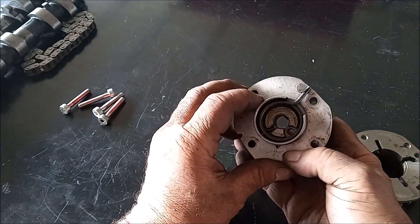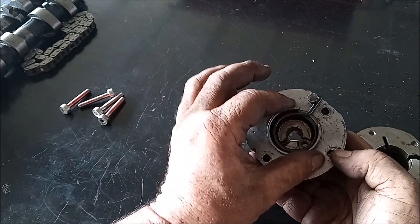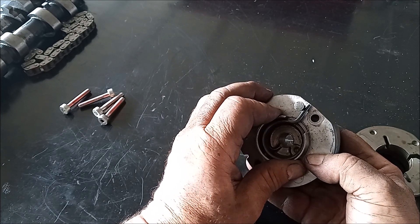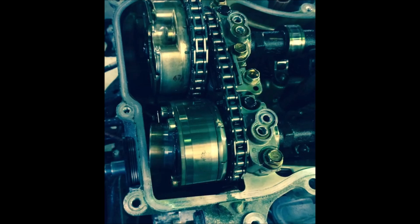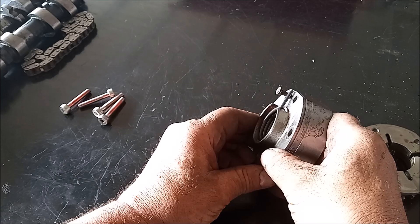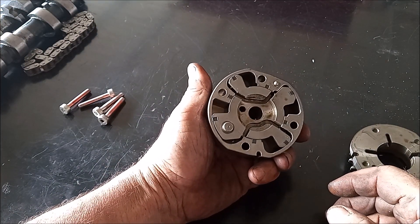This spring mechanism was a weak point on some of the early exhaust gears — this collar could break off, and when it breaks off it moves into contact with the timing cover. Here's an example shown in the car with the collar in contact with the timing cover, and here's what it looks like with the gear removed. Eventually if this moves far enough, the entire camshaft jams and you incur some serious engine damage.